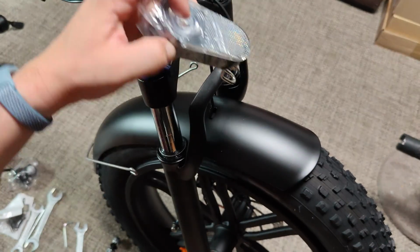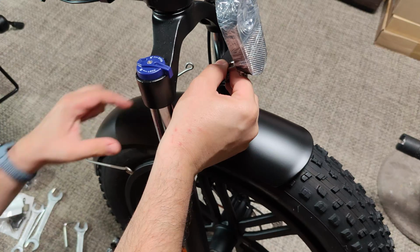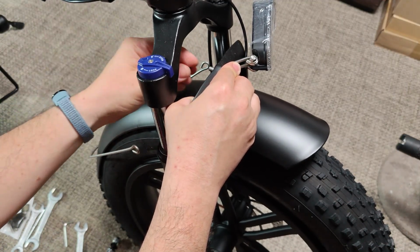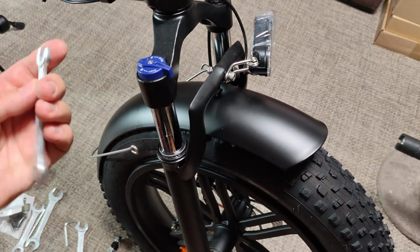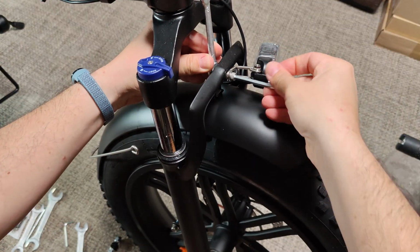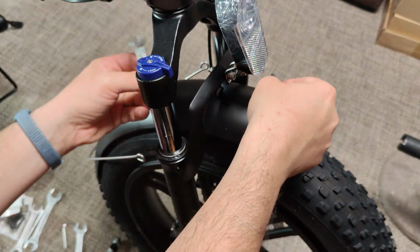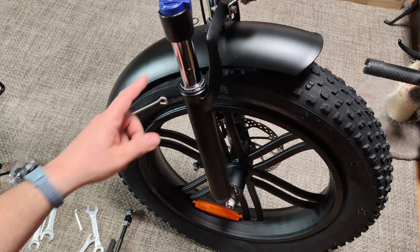So I'm going to put the screw through this with the washer. Goes through this eyelet, then mudguard bracket. Then I'm going to put the washer first and the nylock. Okay, and now we need to hold it again in place. And use the tools so we get it back on. And then of course put this in the correct position, and the mudguard can be adjusted up and down. But I'm not just going to do that now because we have also the brackets to fix.